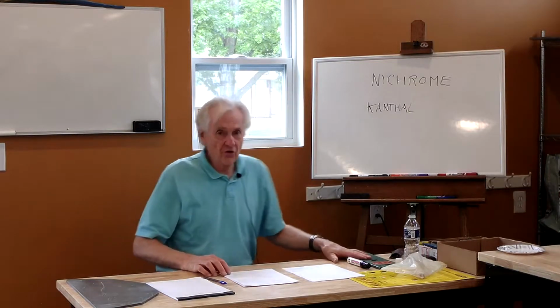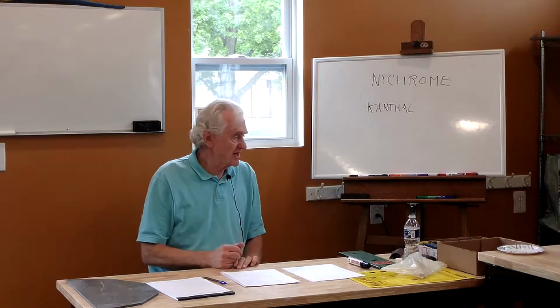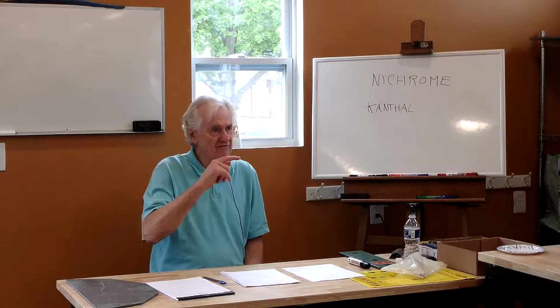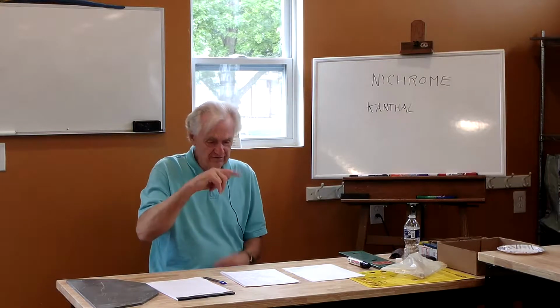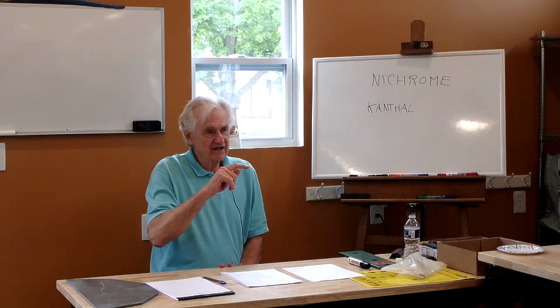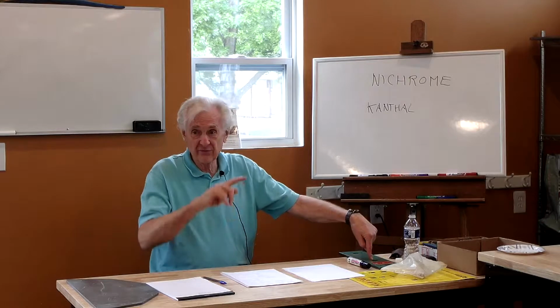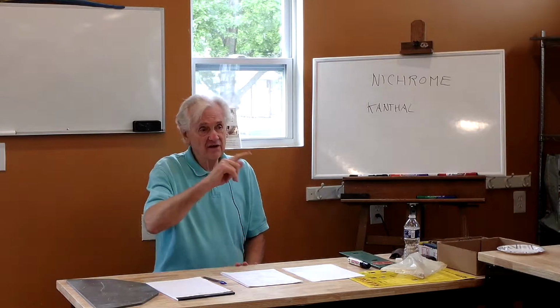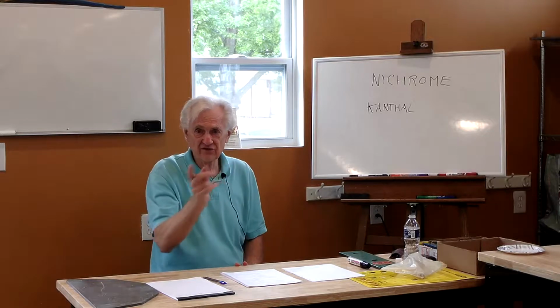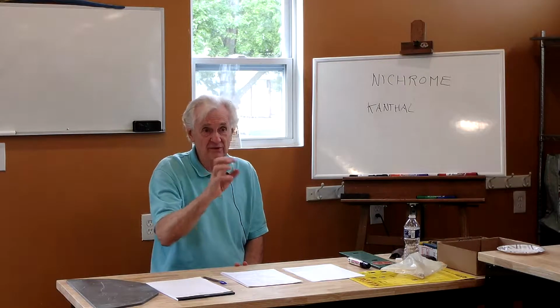So then these are just on-off switches. Then what they did, they developed a kind of switch that actually had a built-in timer, and you'll see them, and they have like a range on them, and they're called variable or infinite. Actually, they call them infinite switches. They also had ones that went low, medium, high, and then they went to ones that were like 0 to 10 or different settings on them. And they basically had a built-in timing mechanism in it.